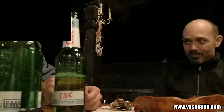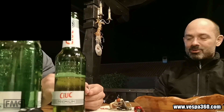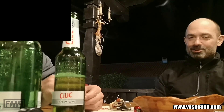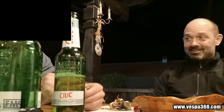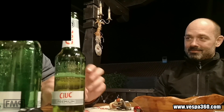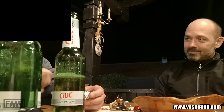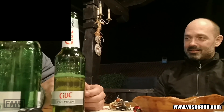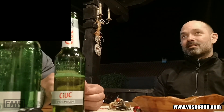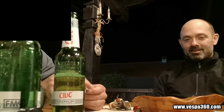I've sort of given up with it — I'm sick of cleaning it, I just leave it. In Brazil, guys scootering around would just disconnect the front drum brake because it was useless, relying on the rear for everything. Ours is the first Vespa — since I bled it and put nice new pads in and cleaned the master cylinder — that has the most progressive feel, where you can really take it right to the limit. And I think the Ohlins on the front makes a big difference too, giving you more grip and helping braking a lot.